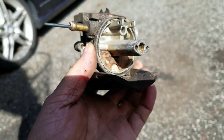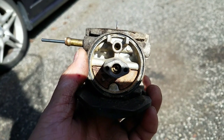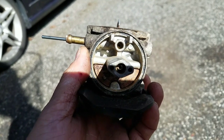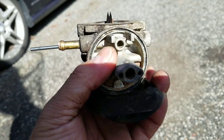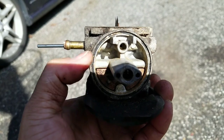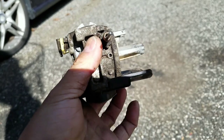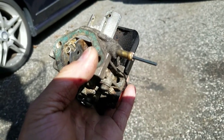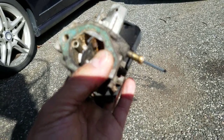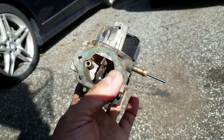There are two little tiny jets in there too - I blew them out and it goes through, but they look like they could unscrew. I wasn't able to do that - it's just too corroded. I feel pretty good about it, except the fuel inlet is blocked really badly. Probably an inch worth of corrosion and gummed-up stuff in there. I blew air and carb cleaner through everything - just won't clear up. I'm taking a really thin drill bit and working it in there, rotating by hand in and out to get all the corrosion out. Every time I spin it, there's white rusty dust that comes out. I'm getting there.